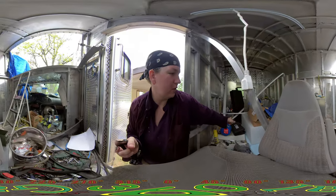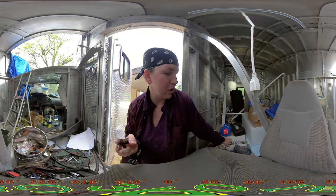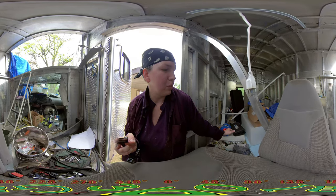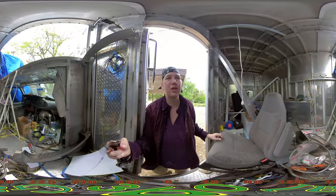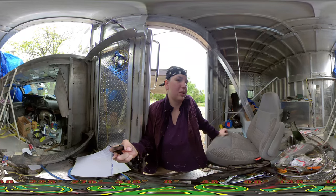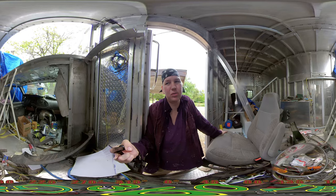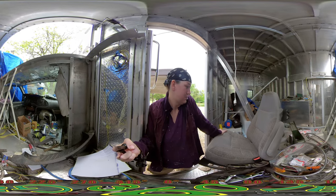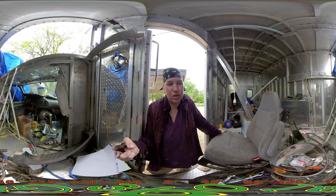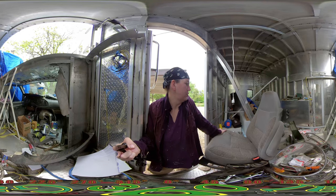I could also work on the actual floor and through the subfloor area, because I got this over here figured out. The water tank and the height of the insulation and everything else, and I could very easily pull that measurement off and start making me my floors and subfloor area. And I think I'm going to do it all out of aluminum, because wood's so expensive at this point, I might as well use aluminum. Which aluminum's expensive too, it's just I save a lot more weight by using aluminum. I already have the skills for welding it, and it wouldn't take that long to do a couple cross braces.